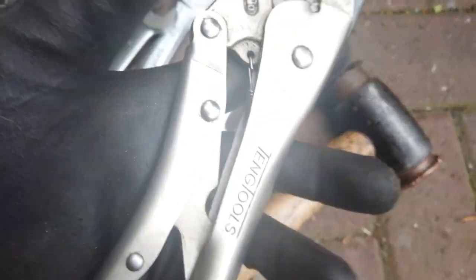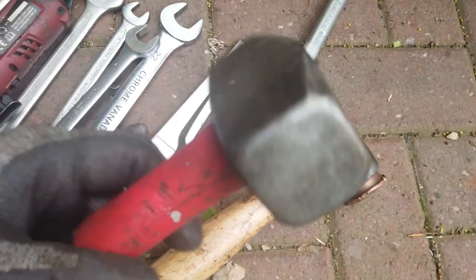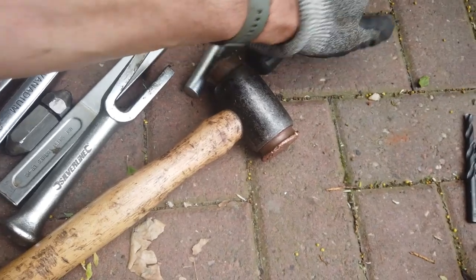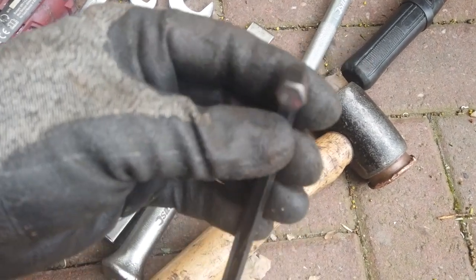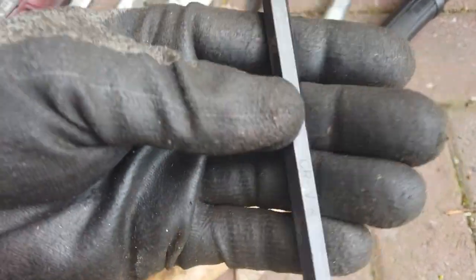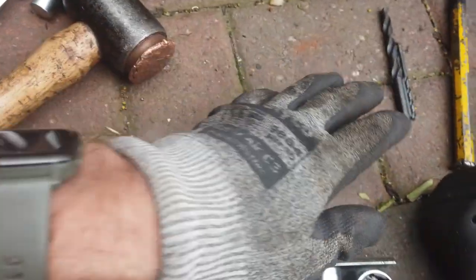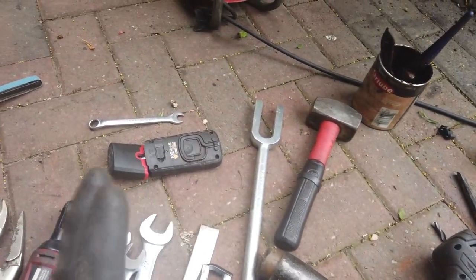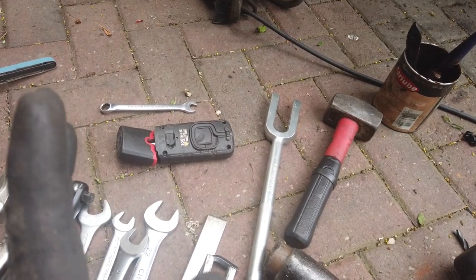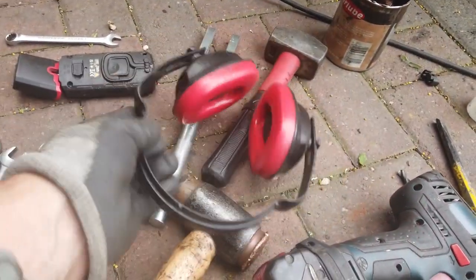17 on the ratchet helps. Copper hammer for striking. Allen key for locking the middle of the ball joint to stop it spinning when you're tightening it up into the hub - you lock the allen key on the middle, you'll see that when you get your ball joints. Drill sockets and drill for drilling those rivets - although that side I struck it and didn't need to drill, it came out. If they do get stuck, drill a little pilot holes. Ear defenders for when you're striking.